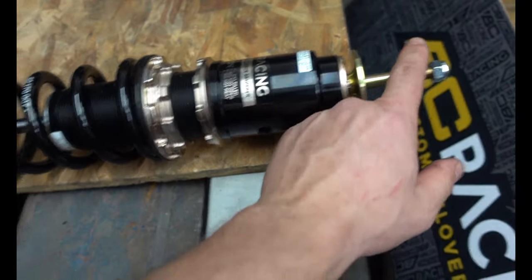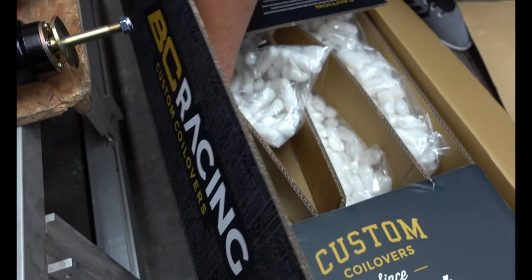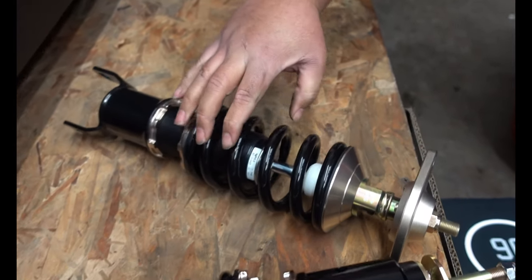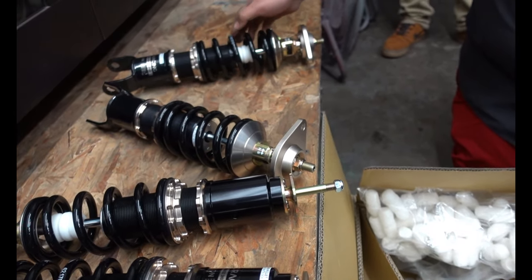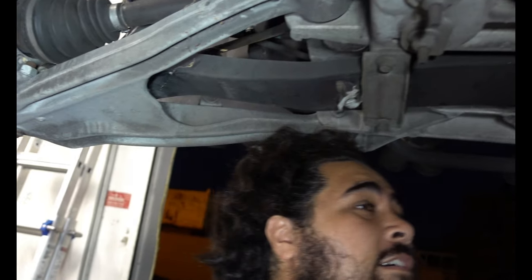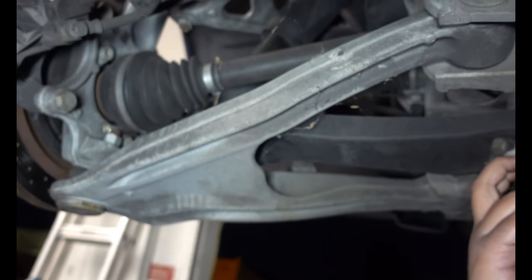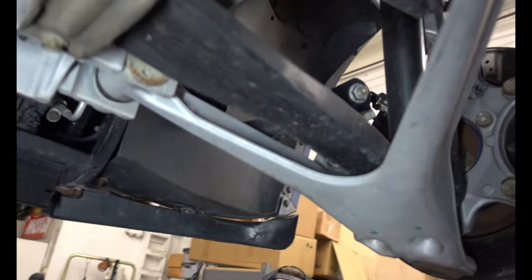So that looks like the front — one nut on the top, two bolts on the bottom. That's the other front. And the rear — two bolts on the top, one bolt on the bottom. This is really simple. But the car has leaf springs on it — a transverse leaf spring. Let's lift the car up and take a look at that. That's the leaf spring going across right here, with two pivot points. Do we need to take that off? We can have double the spring rate, or we can remove it. The front has it too — it literally looks the same as the rear.